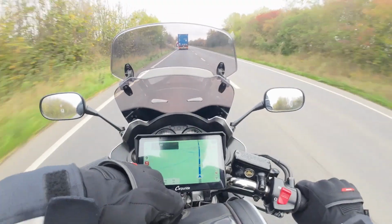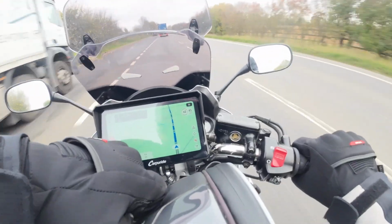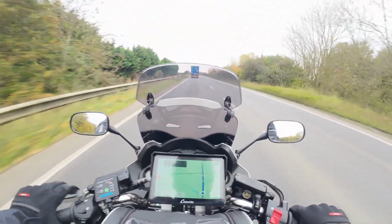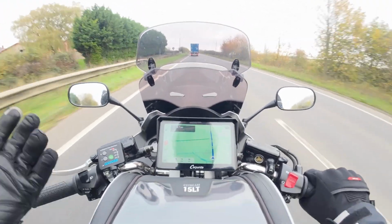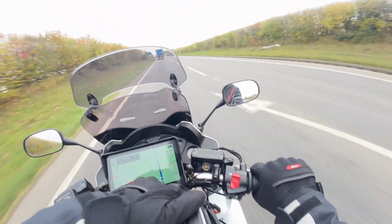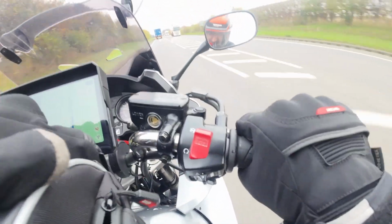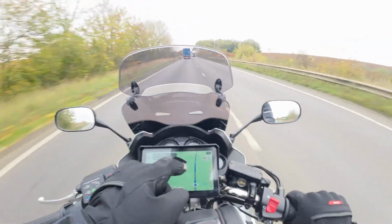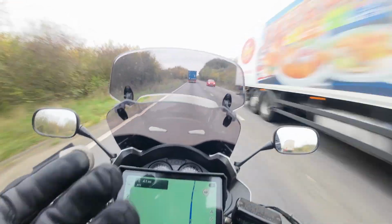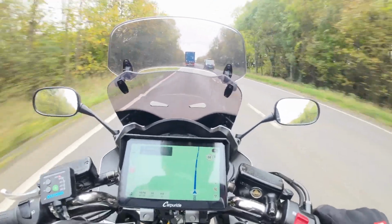Look, the CarPuRide just goes to the battery as well, and it's got this quick release plug here with a little screw connection. But they do say that they're meant to sense low voltage levels, and they cut off after a certain time when it knows the engine's not running. I've also put a little USB socket in down there. It's got a flap over it at the minute, a little eBay job. You see it, a little circular thing there. So I lift the flap and I've got a USB. I've got the grips, I've got the CarPuRide, I've got the USB socket, I've got the Optimate lead, and I've got the obviously the main battery leads as well. So that's five leads off both terminals.